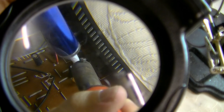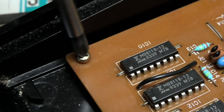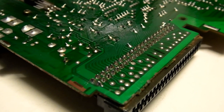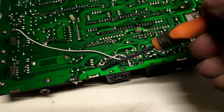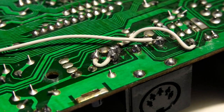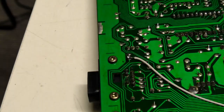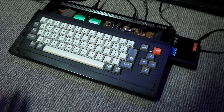I added a bit of solder to the joints to help free up the old solder, then used a solder pump to remove enough to free the switch. Then it was just a case of popping the switch out by squeezing the sides in and pushing it outwards. Now you can take out the screws on the motherboard and lift it out. On the underside I can already see signs of previous work - a lot of solder joints look newer than others. But looking around the video and audio output, there are damaged traces, and testing with a multimeter confirms they are not making a connection. A little reflowing fixes most of them, but three connections had to be patched with wire.